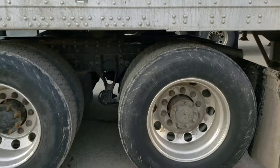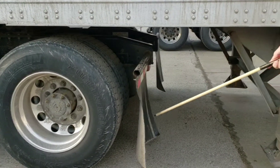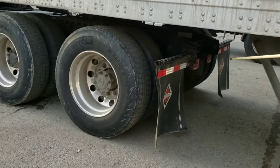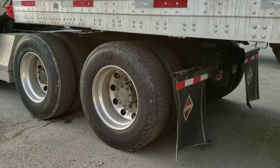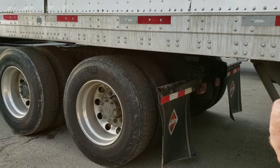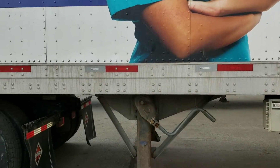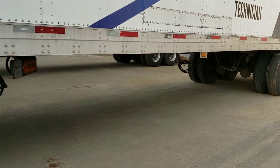Tires are checked for tire pressure with the gauge — you get no points at all if you skip the tires. Mud flaps are in good working condition — they're not broken, they're at the right height. I have DOT reflective tape on them, checking to make sure that's 50% or better. Backing lights, tail lights, running lights, turn signals right and left, and hazards — all in good working condition. Also, these lights act as reflectors — at night if parked and lights aren't on, they should reflect a high beam or low beam enough to identify. So they are reflectors in addition to being lights.